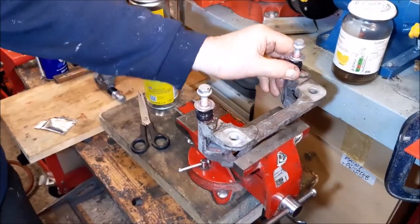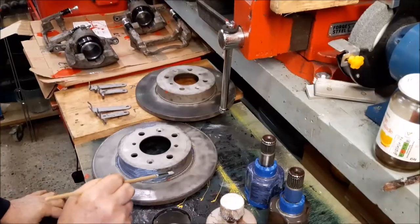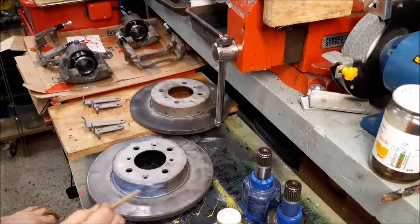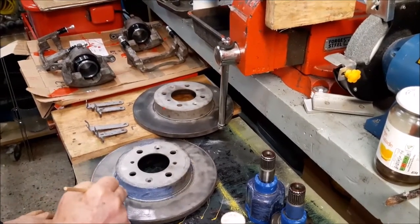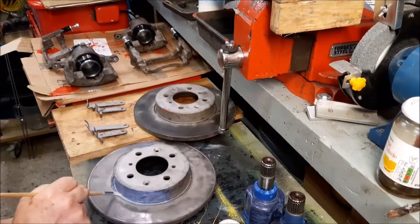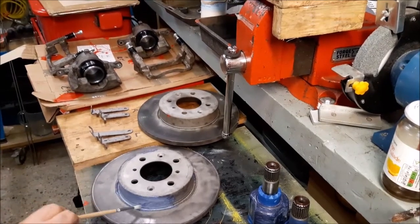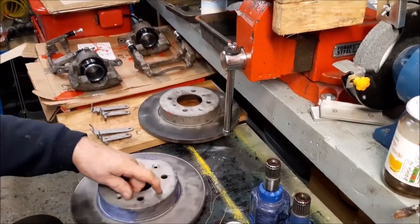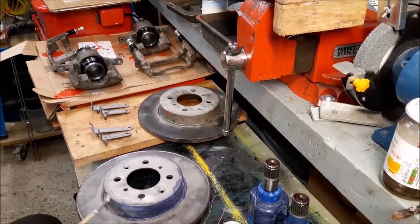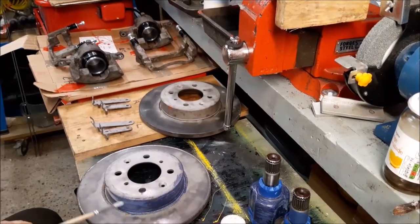Now we're ready and starting to paint the brake calipers and discs. We've sandblasted them, but what you normally find when you sandblast something is the rust starts to come through straight away. So we're covering them in the rust killer — we use Bilt Hamber rust killer. We're going to go over all the areas we're going to paint, and that gives a better surface to then put the paint on. All the brake parts are now painted with the rust killer. It also gets rid of any little bits of rust and acts like a roughing-up undercoat.